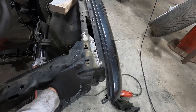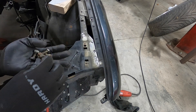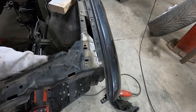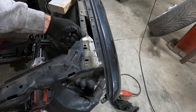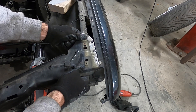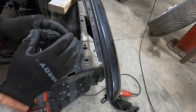Here is the plan: I've got five through bolts with nuts, and I'm going to weld all the nuts on the backside so this is completely boltable and can be removed in a heartbeat. The five locations are: one up here, one over here, one over here, and two right here underneath. I'm not going to reuse the old holes — this will butt up just fine, and the fender will be overlaying it. Five bolts will hold this in place no problem. Let's start drilling, welding the nuts, and cutting bolts that are too long.